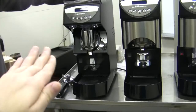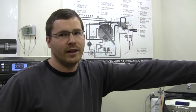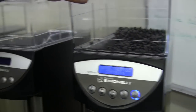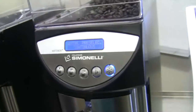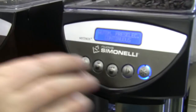So the Klima Pro over here is for a more high-end, very focused single-origin shop. The middle one is sort of the run-of-the-mill entry level. And the tamper model takes any guesswork out of consistency for your barista — this is how you turn a traditional machine into a super automatic. Combine this with a volumetric machine and you basically have a two-step super automatic. The Klima Pro runs at low RPM, so dosing takes about double the time: 3.7 seconds on the Basic versus about 7 seconds on the Klima.